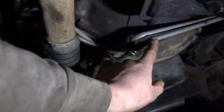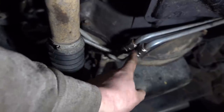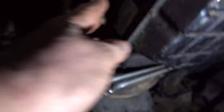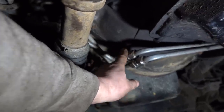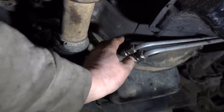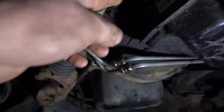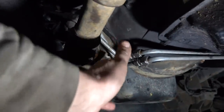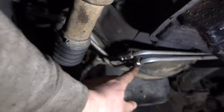These transmission lines — one was fighting me. I have swage lock connectors on there because these tubes were originally cut. When I had the 48RE swapped in, I used a swage lock and ran our aux cooler through there. The 48's cooler lines come on the driver's side, so I had to make something up that would work, and that was the solution to put it back to a 68RFE.